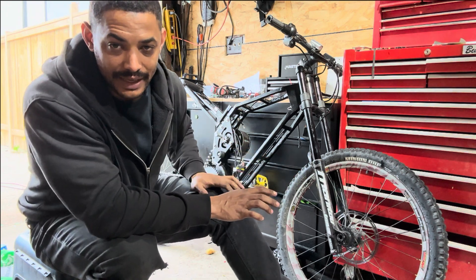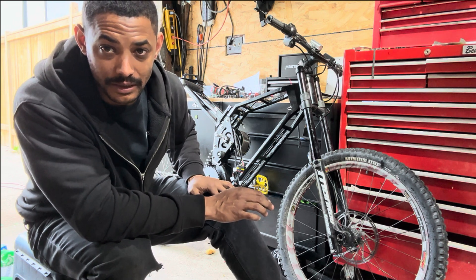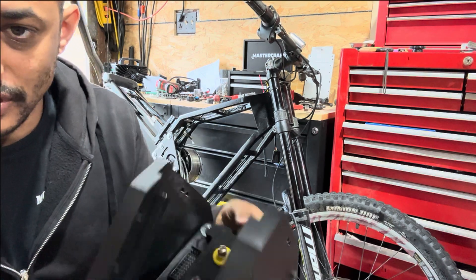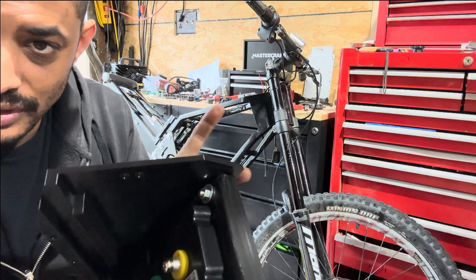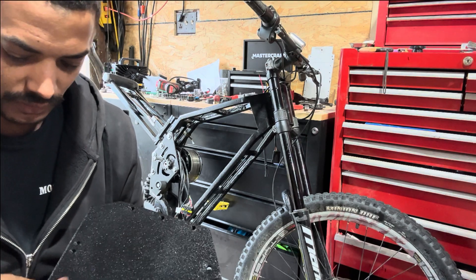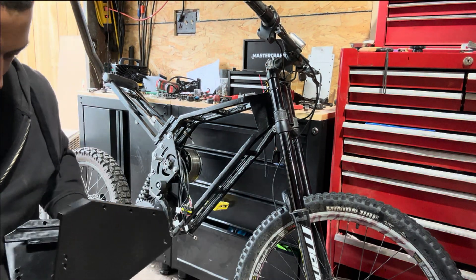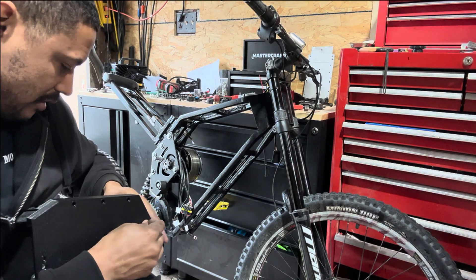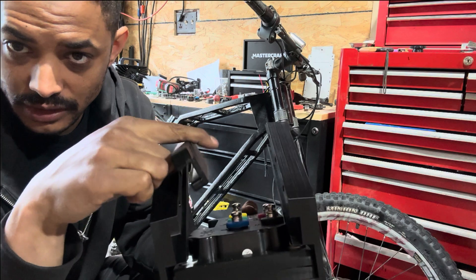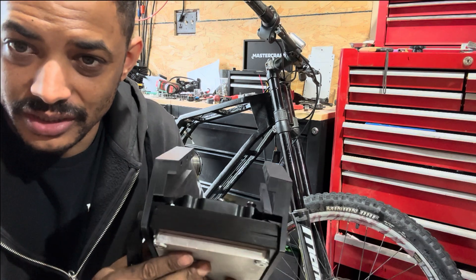The bike is moving in a better direction. And that's plumbing — let's get the bike back together. I got this ring that slides over top of the Far Driver controller, and that allows me to bolt sideways — just thread-in inserts. So that ring gives me a sideways bolting and I can put that on — it's just loose — and this slides over the frame. This attaches it on but keeps it open. Boom — it's in. You can see there's a vision here; it's not fully hideous.